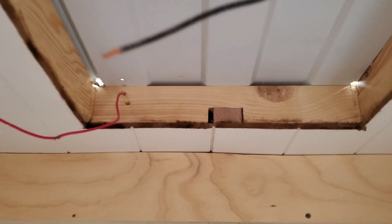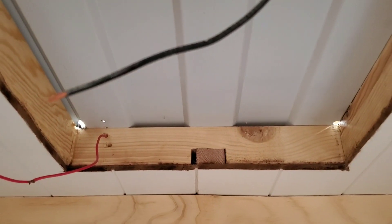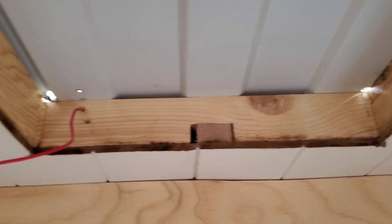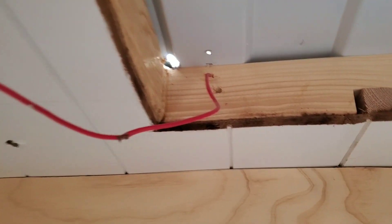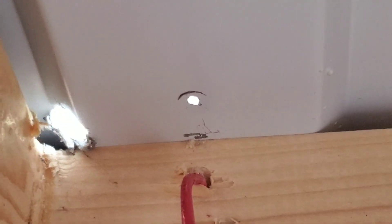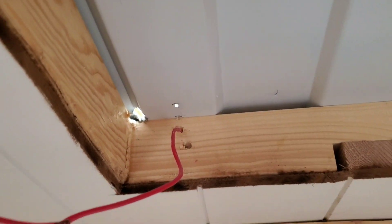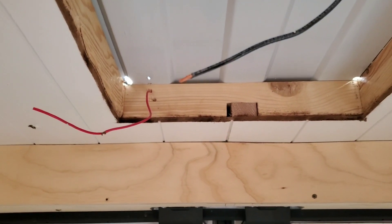One thing I do — this one I already framed in before we did the spray foam. We're just now putting the Maxxair fan in. Since I already have my wood frame, I'll come in the corners and drill my marker holes. And since I already have my wire run and I don't want to cut it, I'll go right there on the inside and drill a small hole right in line with the wire. That way I know when I get up on the roof, after I tape it off, I can make a mark so I know where that wire is.